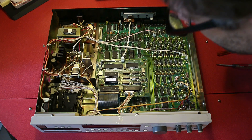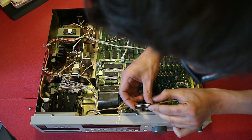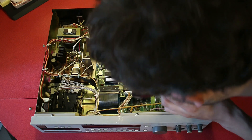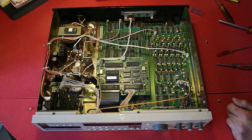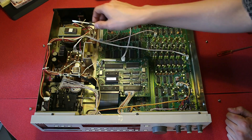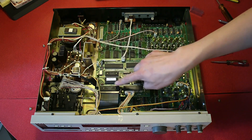This is quite common when you get a chip and you're trying to insert it — generally the legs are spread a bit wider than the socket, so you can squeeze it on a metal surface. Just very carefully on the edge, just bend them in a little bit, and on the other side too. Make sure that the indentation on the top of the chip is on the opposite side from the power supply and the floppy disk, so it will be inserted in the same way as the old ROM. I'll just press down uniformly, and it's gone straight in.